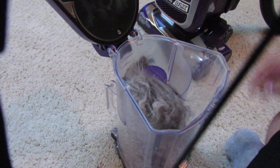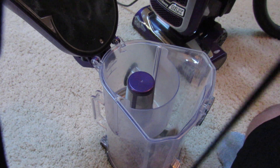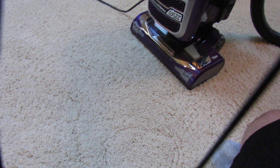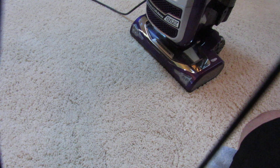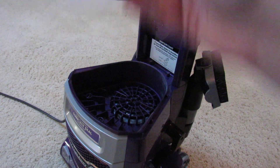Most of it is wrapped around the cyclone interior — the inside of the cyclone right here. This is the cyclone. I've had this vacuum for two days now and the filter has some dust on it, but it's less than I expected. No dust has really gotten into the post-motor HEPA filter, the one that captures all the pet dander and allergens. That is because it has two pre-motor filters — here's the foam pre-motor filter, and there's a second felt filter right here, and then there's the motor.